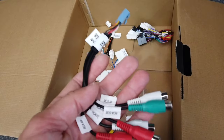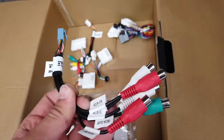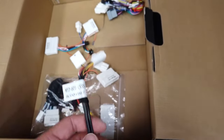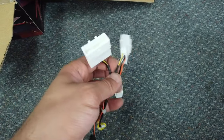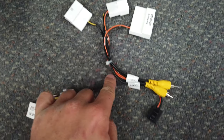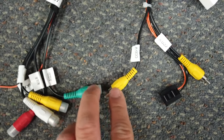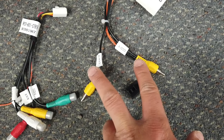This is an audio harness — if you wanted to connect an aftermarket subwoofer or some speakers you can do this by connecting it to the Tesla unit and then using the RCA outs. For the factory reverse camera, if you wanted to connect it, this is the harness you need to use. One of these will go to your factory screen connector and this will go to the head unit, then you follow the signal line. Whichever one works is the RCA you'll need to connect to the harness with the green connector. Match the CCDV together. This will go to the Tesla unit and you'll only be using one of these RCA cables.